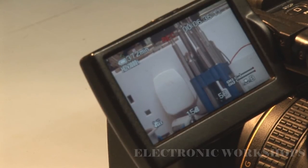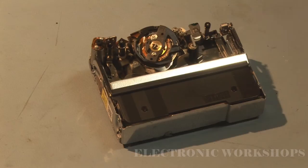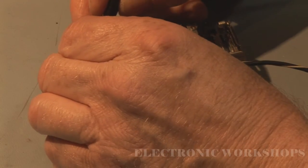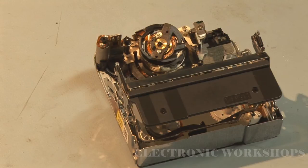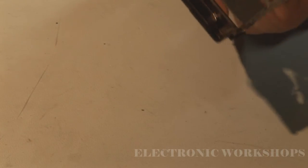I have the deck out now and I'm going to put the tape deck to its eject position. I do that by using a power supply - I switch it on and set the power supply to three volts and limit the current to under half an amp. I apply it to the load motor here and it's now in the eject position.